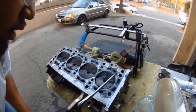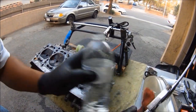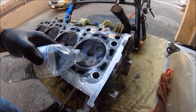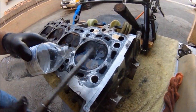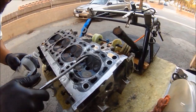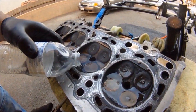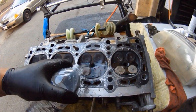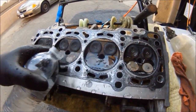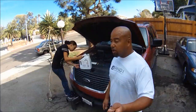I flipped the head around — these two intake valves were the ones leaking really bad, so I flipped it around and leveled the exhaust side. This is the bad side right here. We got bubbles here, leakage there. Let's check this side — we got leakage there. Now we know we definitely got to grind these valves. Let's check these real quick — it seems to be good, little leakage there, see the bubbles. And that's how you check leaking valves.